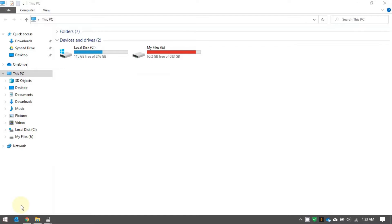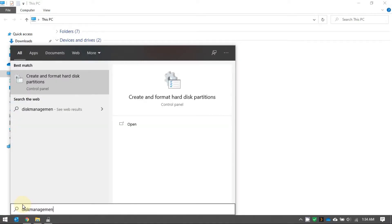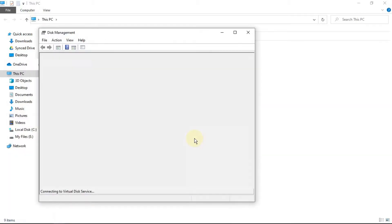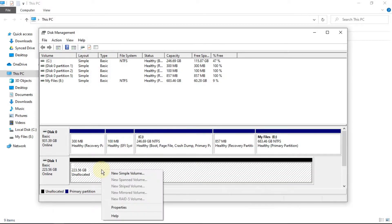Doing that is optional since the cloning of the OS would take care of it, but I decided to do it anyway. To do this, go to the start menu and type Disk Management. Clicking on 'Create and format hard disk partitions' will open up the disk management window. As soon as that happens, a pop-up comes up for initializing the disk. You can also see the SSD as disk 1, which is uninitialized. Choose the GPT option for partition style — this is the newer one and is a better option.